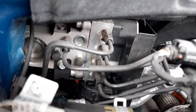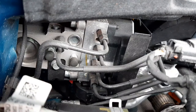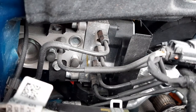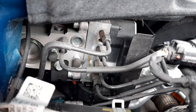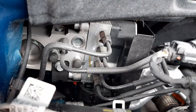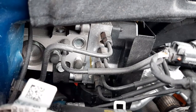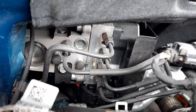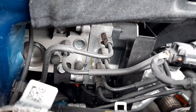In the rear offside front of the engine compartment, you have your integrated brake actuation unit. In hybrid vehicles like this one, a special braking system is needed. On the unit itself, you've got the electronic control unit, your four pipes going into each of your wheel cylinders, and other components.